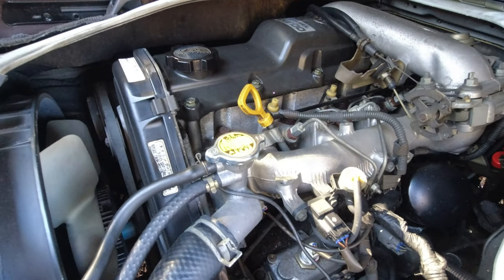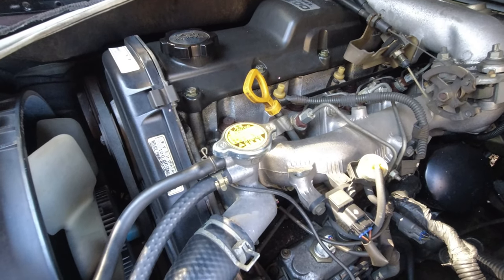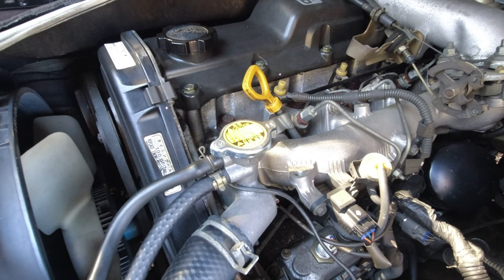So if you get one of these, make sure you change the gauge water temp sensor at least. Ideally, you'd change both the gauge and the ECU water temp sensor. Secondly, the radiator cap and the cooling system. The earlier models were 13 PSI; the later models are 16 PSI, like this one.